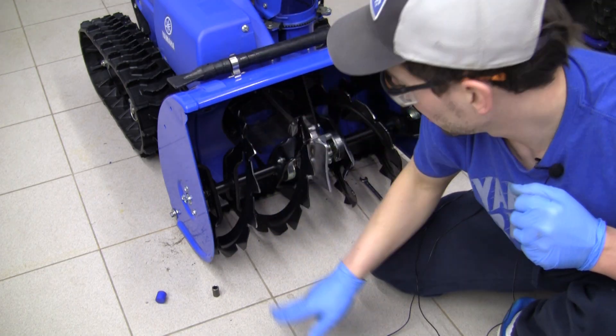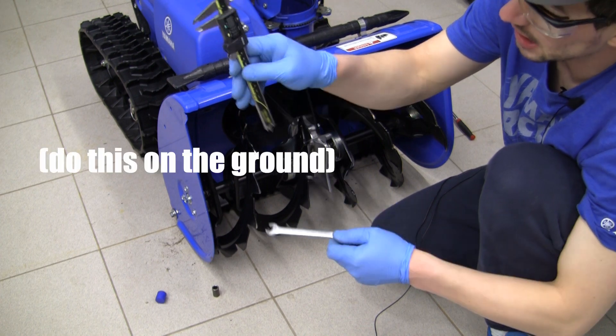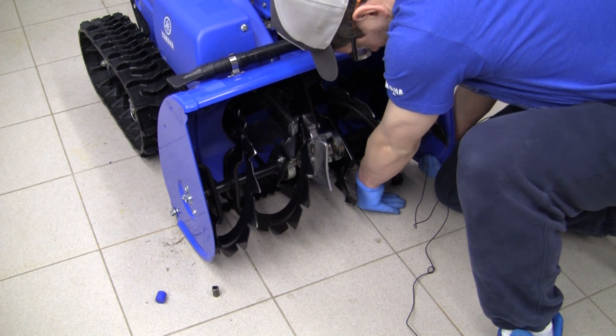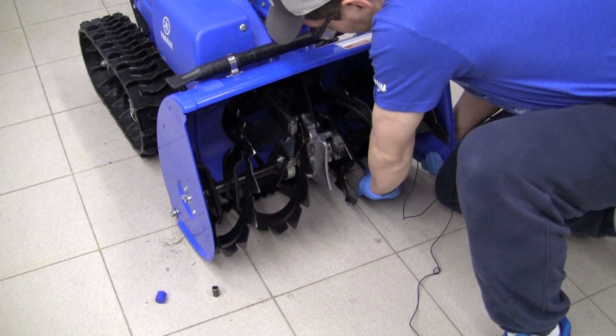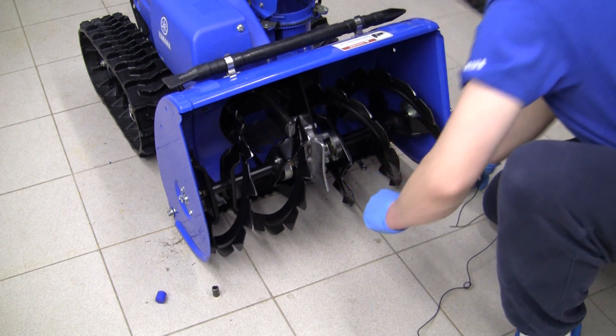I put Loctite on the end bolts — even though there's a lock washer, the nut isn't a locking nut. On the back nuts I didn't put Loctite because those are locking nuts. I've snugged them all up. I'm going to put about six to seven millimeters height under the scraper. I've lifted the snowblower at the back, let the tracks down, and put a wrench underneath. Using the caliper I got 7.3 millimeters, so it's in the middle of this wrench. I'll increase it slightly considering everything flexed down a bit.